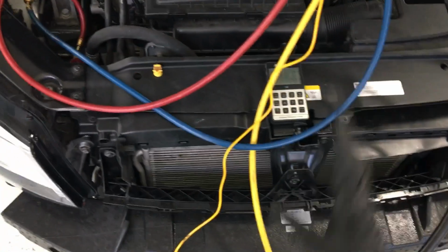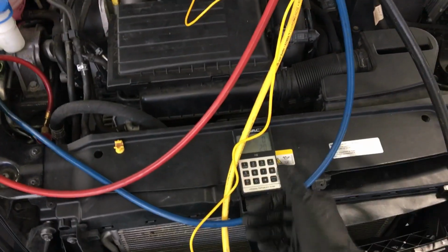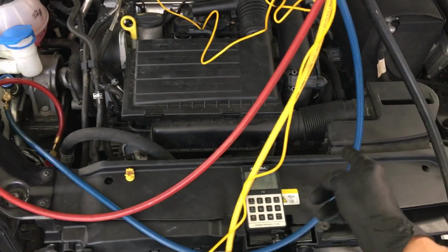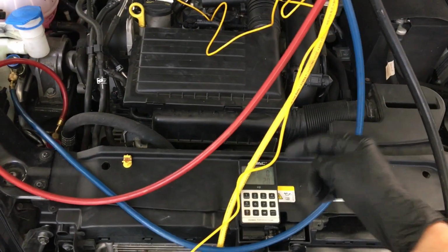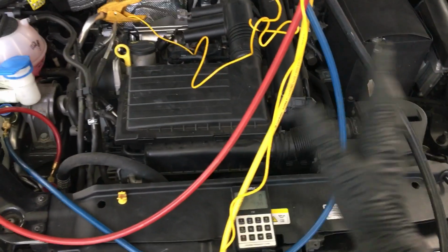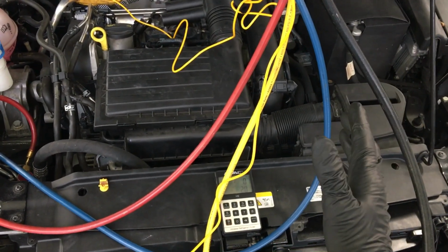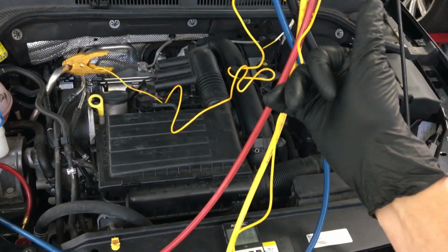You would never know, because the refrigerant was feeding in while you didn't look at it, and it's going up, and you went over to disconnect something, and then you turn back and it's up while it was already up and you didn't know it, and it's telling you it has 120 grams more or 120 grams less. And when you're dealing with a system right around a pound, 120 grams, you're approaching 3 ounces of refrigerant. 3 ounces of refrigerant on a Prius is enough to send it over 440 psi on the high side on a hot day and shut the system down. That's how bad this is, and guys do this all the time.